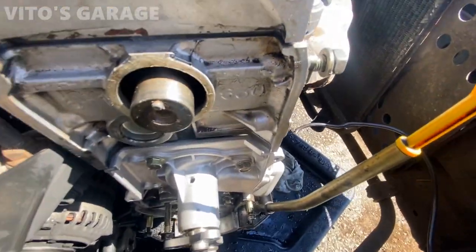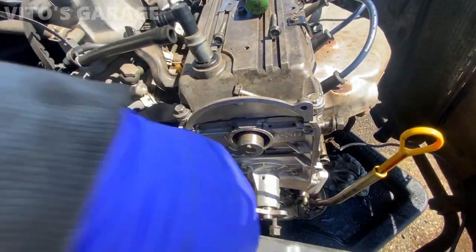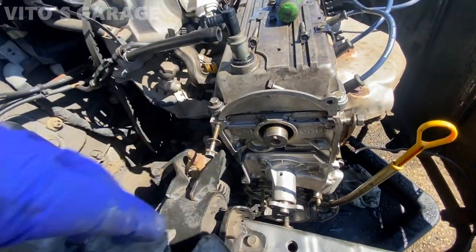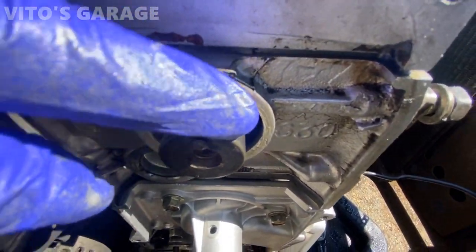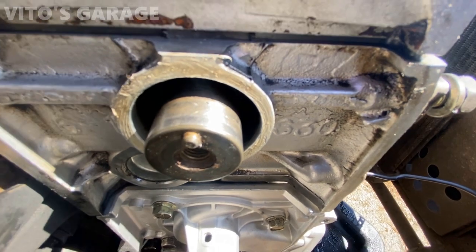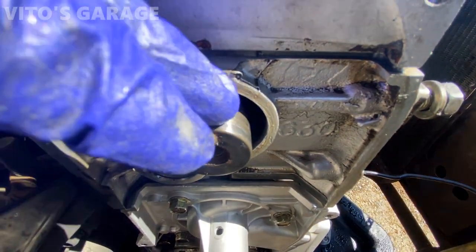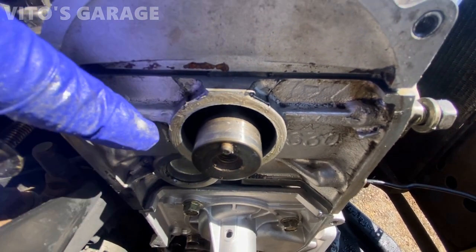All right, water pump is installed, all torqued. Everything looking amazing here. Cool, I'm gonna start working on my cam and crank seals. All right, so hopefully this doesn't create any problems, but I noticed that inside of it previously, someone scored the camshaft, probably removing the seal right there. So there's like a small gouge right there where the seal is riding.